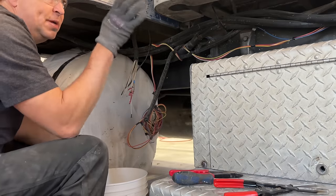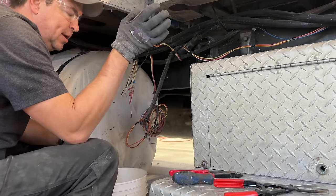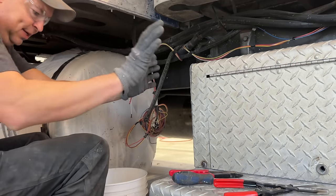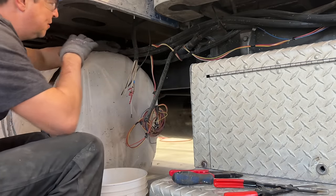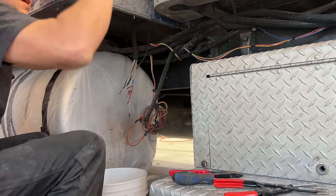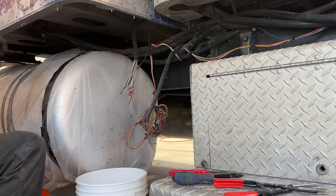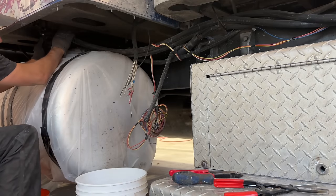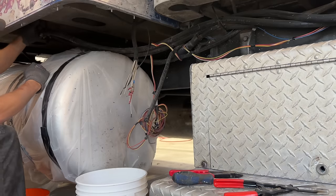So as I was mentioning, I got those shutoff valves closed, so hopefully that'll hold all the coolant in around the engine and in the radiator. But there is still going to be coolant from the heater core and then whatever's in these lines. And then I've also realized that as soon as I pop this line off, all the coolant that's up in this heater core, probably at least a liter, is gonna come pouring out of there. So this is gonna make a bit of a mess.